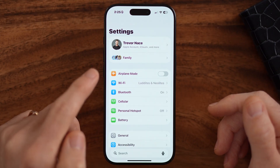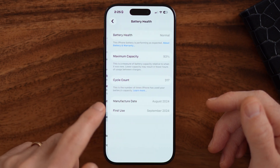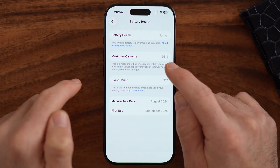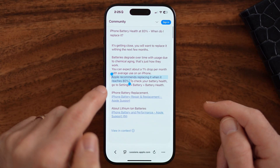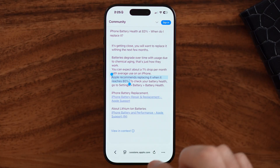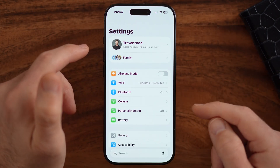Let's get into the settings app of your phone. The first thing we'll do is check the baseline of where your battery is. Go to Battery Health and check to see if battery health is set to normal and max capacity. Mine is at 93%. You can expect about a 1% drop per month, and Apple recommends changing or swapping out that battery if battery life goes below 80%. If it is below 80%, you might want to consider replacing it — it's usually about $100 to $150 for Apple to do it. However, you don't necessarily need to do that, because there are a number of things we can do to increase it just by changing things in the settings.